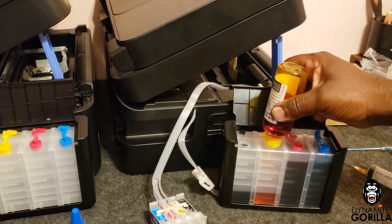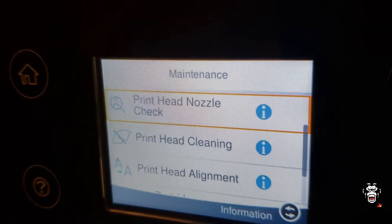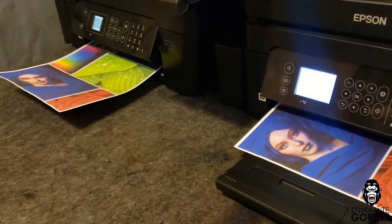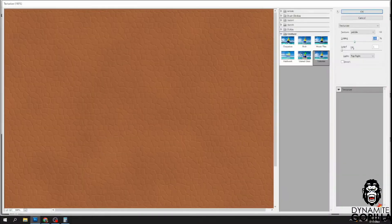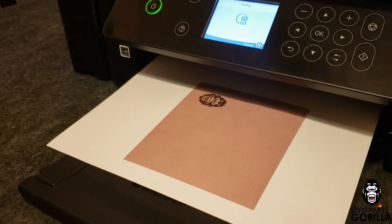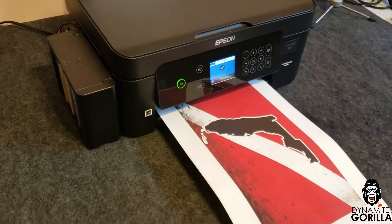I'll be using regular refill ink for the WF2850 and the WF2830 and get those set up. Then I'll plug the printers back in and turn them on to make sure there are no error messages, run 3 head cleaners followed by 3 purge files, and repeat until I get a good nozzle check. Once I get a good nozzle check, I'll do a couple of test prints to make sure nothing pops up in an actual print. To test the sublimation on the XP4105 I'll work with a wallet blank — the blank is smooth so I'll create a leather texture in Photoshop to get the look I'm going for. It looks like I'm able to print without any errors, everything is in working order, and I now have added ink capacity without needing to remove cartridges to refill them. Doing it this way is a cleaner install and the SIS looks like it's actually supposed to be there.